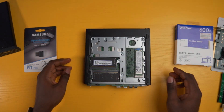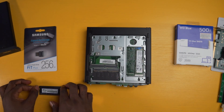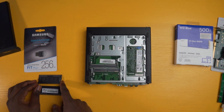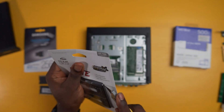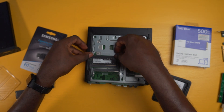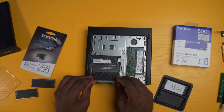To remove the old RAM on the motherboard, gently push down the clips on both sides to release the existing RAM. Take out your new RAM stick from the case, align it with the slot, and press down firmly until you hear it click. Just make sure that the notch on the RAM is aligned with the notch on the slot.